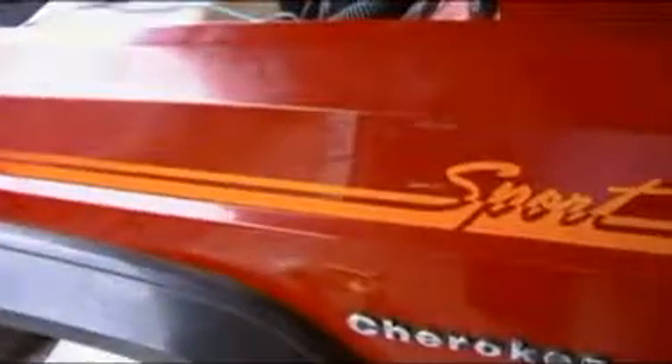Let's go over the list real quick — made a video of the list of things I wanted and needed to get done with this thing. The top one says brake light is out. Fix the front turn signals — got them working. Headlights, haven't quite figured those out yet. Working on bleeding the brakes. Did an oil change and filter the other day — awfully black coming out, real thick, so I don't know what weight was in this thing before. Haven't done any other fluid changes. Got the fender put on — there's proof.